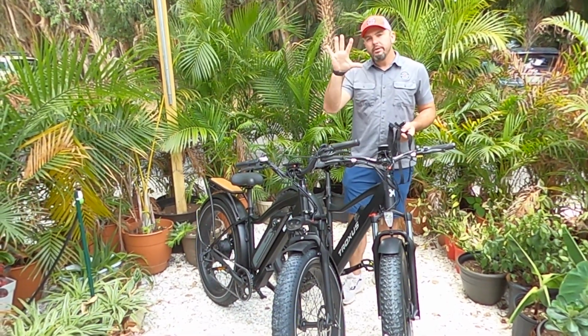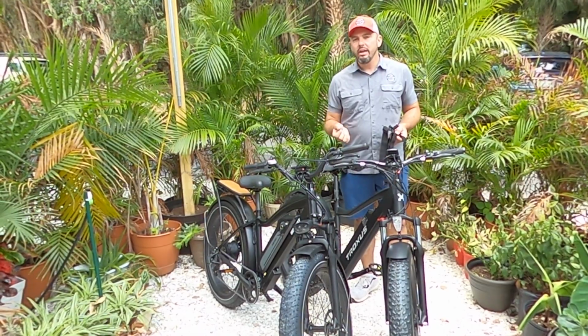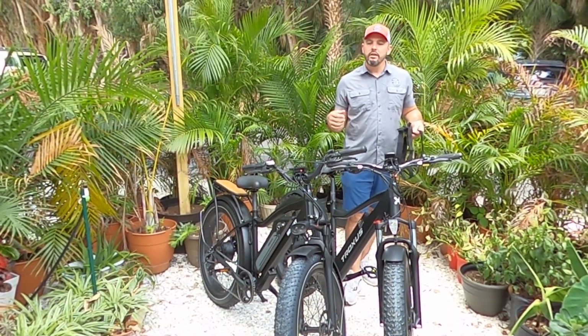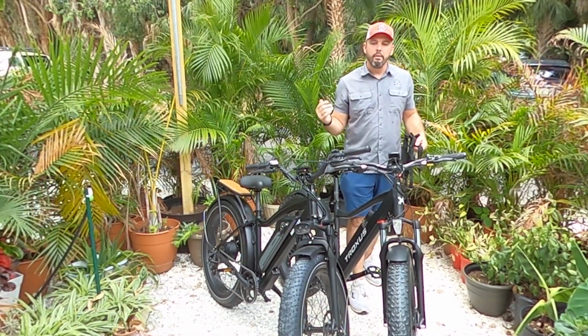Meaning, if I only have 5 levels of PAS, a lot of bike manufacturers start out that first power input at like 25. A lot of electric riders will know this, because electric bikes got a lot of grief for PAS 1 being very jerky. A lot of power in PAS 1.